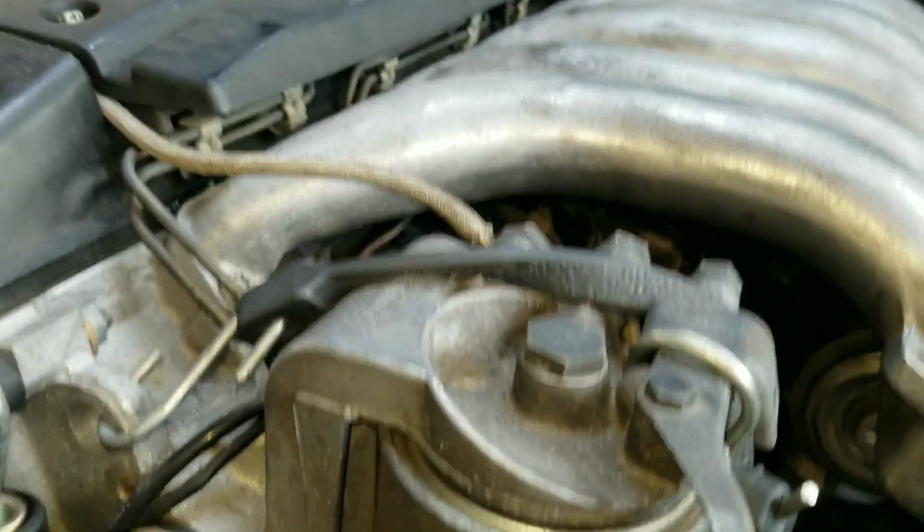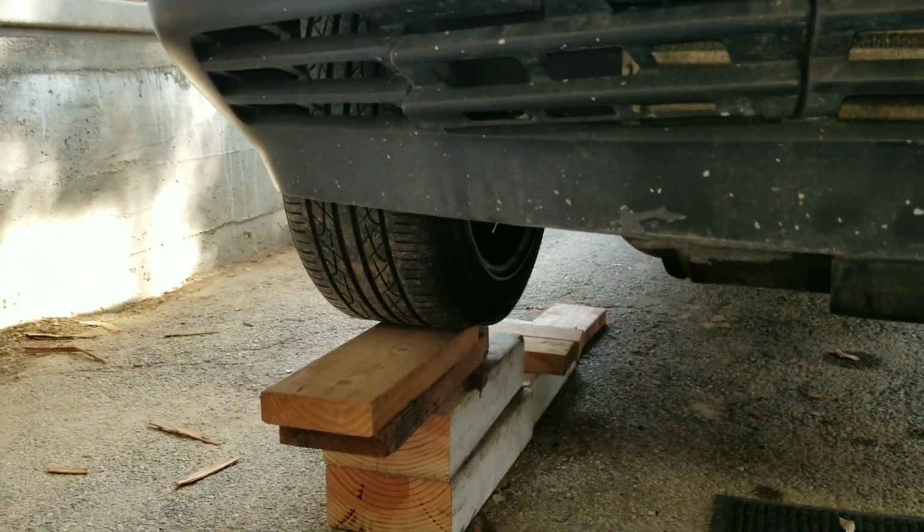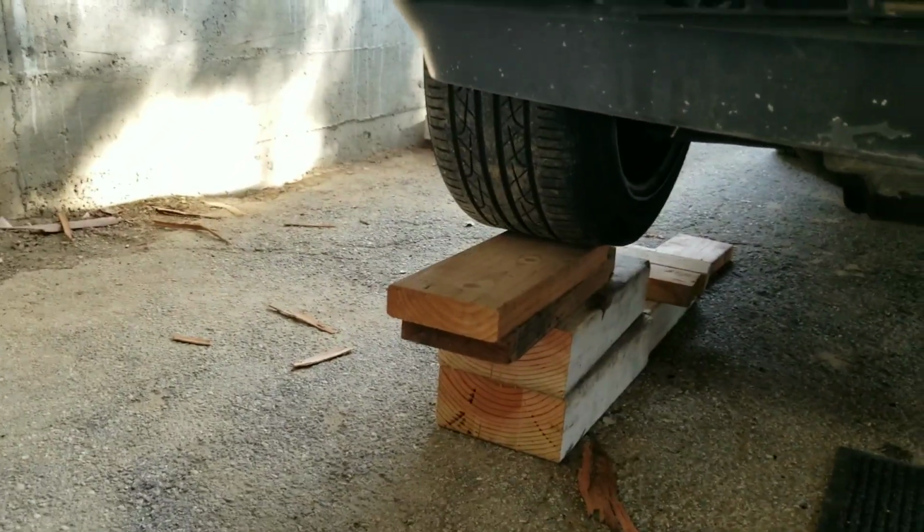motor. All right, mechanical pump, 6mm elements, maybe a little more than the motor ran stock, but not a whole lot. Drives nice. Have a plan to upgrade the pump, put more fuel through the motor. Therefore, needed to figure out how to get enough air in there to burn the fuel. Got a compound turbo setup.